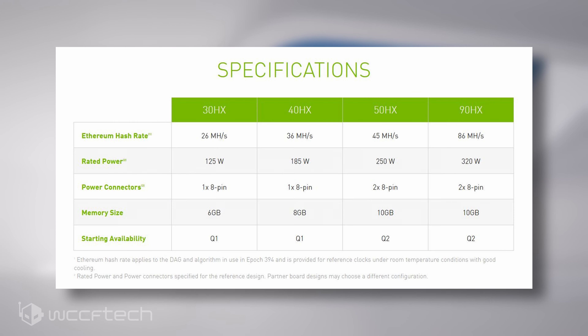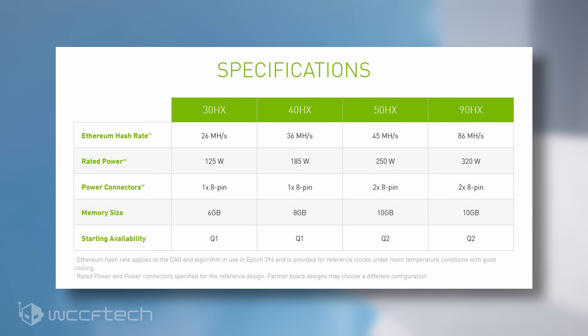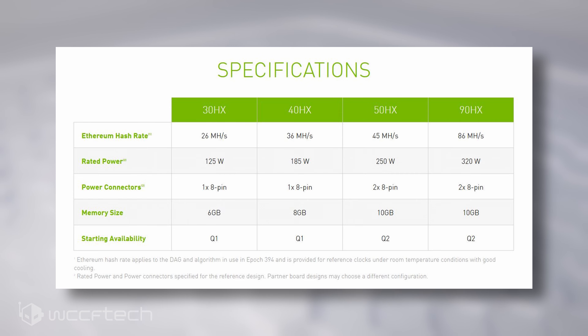But thanks to VideoCardz's catch, we find out that at least for the CMP 30HX and 40HX, that won't be quite the case. When the cards were first announced, I had my suspicions on what cores they would be using by simply comparing existing cards' stock hash rate and memory capacity along with power draw. My original thoughts on the 30HX were that it would be based on the RTX 2060 TU106 core because that's about where it hits on hash rate, but I failed to consider the GTX 1660 Super and it having the same memory configuration. The 2060 Super and the 2070 both land at about the same hash rate and power draw, so that was a fairly easy assumption, and according to the 461.72 drivers, it appears to ring pretty true.